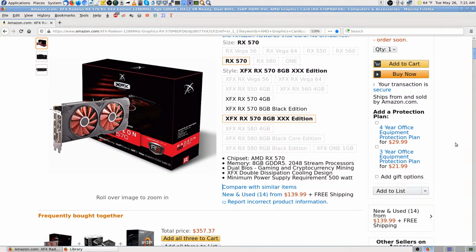And so that's when I bought the 650 watt, because I knew at some point I was going to upgrade it. And so anyway, give yourself some headroom, quite a bit. I would say give yourself 50 to 100 watts of headroom of the constant rating too, not the top rating, not what they advertise, but the constant rating. That's why I was showing that constant rating on the server power supply.